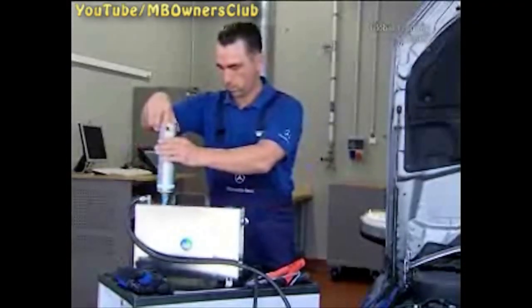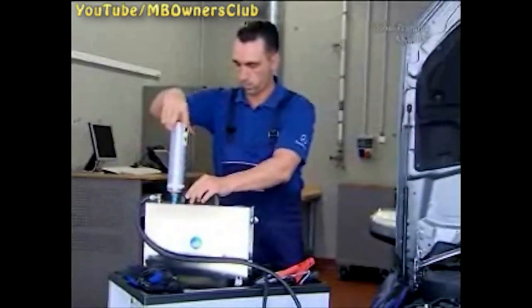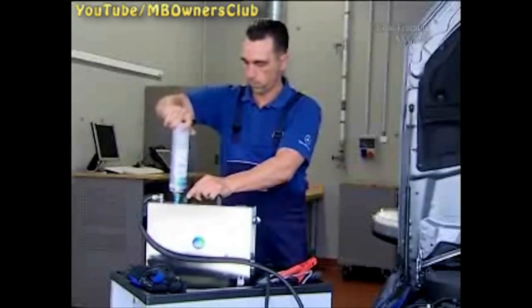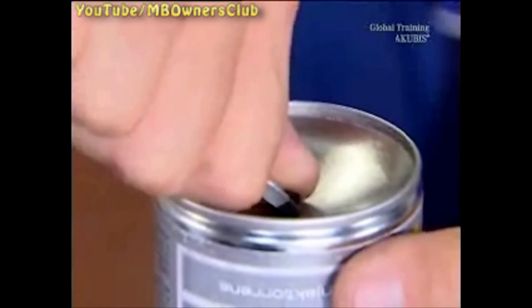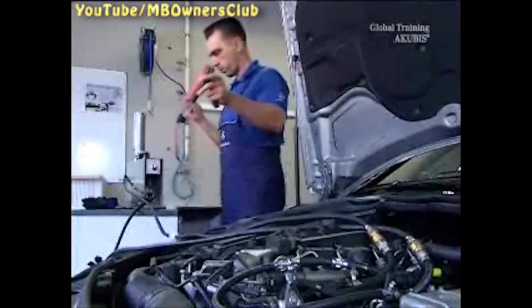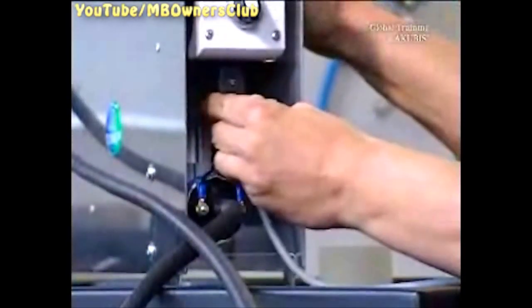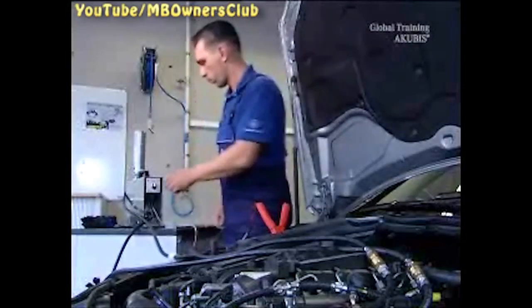Fill the tank with a can of MP127 cleaner. Turn the can and put it into the fill adapter. So that it empties completely, be sure to remove the rubber stopper at the bottom of the can. Power the unit with the vehicle battery — insert the plug and connect the alligator clips to the positive and negative terminals. You can hear the pump running. Wait about a minute until the lines are bled.